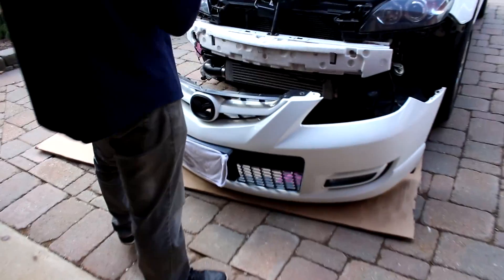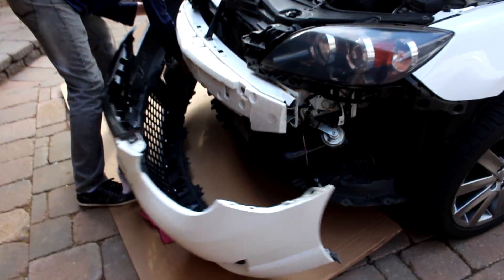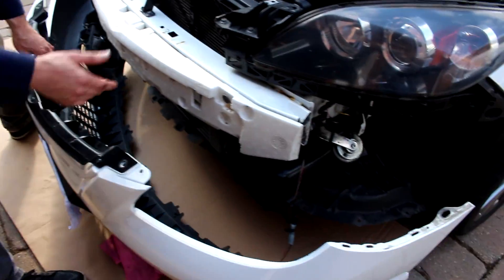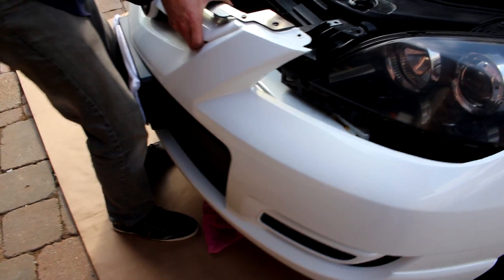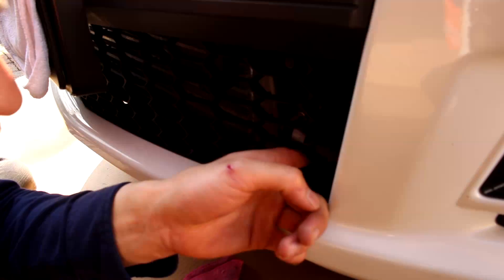All in the name of airflow. Here is the passenger side — going to take this bolt out right here and use it to mount this side. That bracket came with the front mount intercooler kit — the JBR front mount intercooler bracket kit — it's to hold the power steering lines at the front of the intercooler. Does that look good? Is it clearing all around? Looks really good — it's clearing all around. It's all done, just gotta put everything back together now. That's going to force all the air this way instead of that way. We're gonna put the bumper back on — our little plates on the sides look pretty good. You won't even be able to tell they're there once the bumper is on.